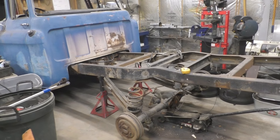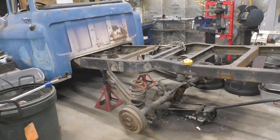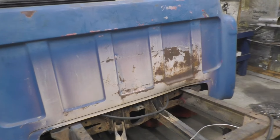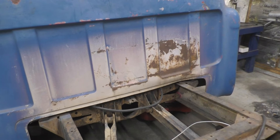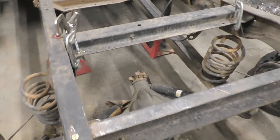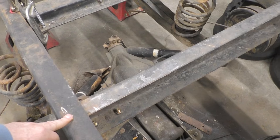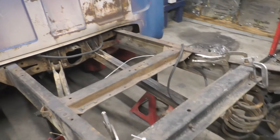We've got the late 60s/early 70s Chevy rear suspension part of the way in. The front cross member actually fit in and just had to drill a couple extra holes. The rear cross member that holds the track bar was the same way — these are the holes that were in the frame before with the track bar on it, so that part was pretty easy.